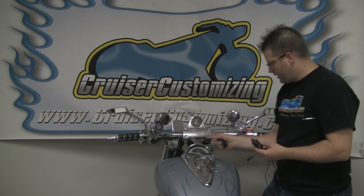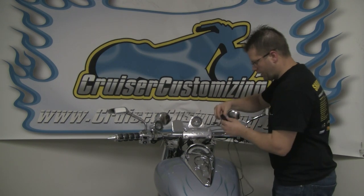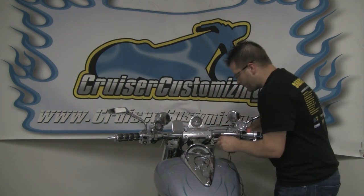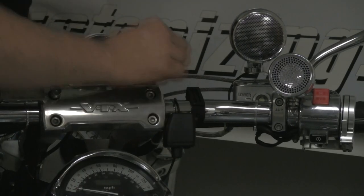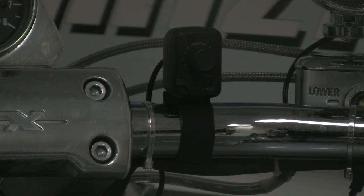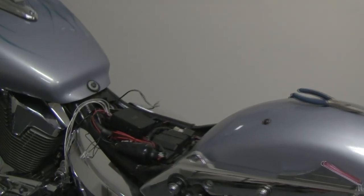Normally I mount the volume control on the left-hand side, but because I'm running two sets of speakers and I've got my iPod dock already over there, for this instance I'm going to install the volume control on the right-hand side of the motorcycle. I'm going to take the supplied clamp, separate it, and lift it over the bar. Then I'm going to take the supplied screw and put it in place through the bottom. With my volume control in place, I'm now going to take my cable and route it over to the amplifier.